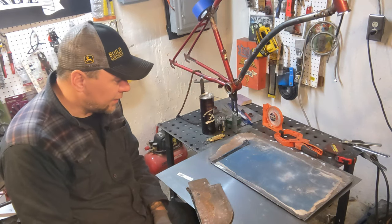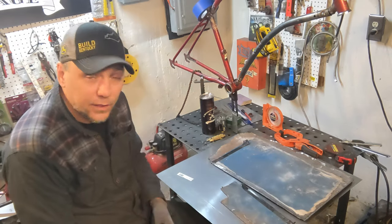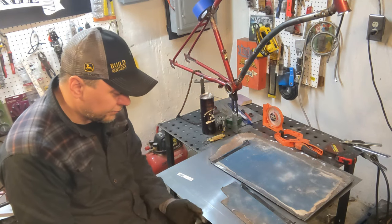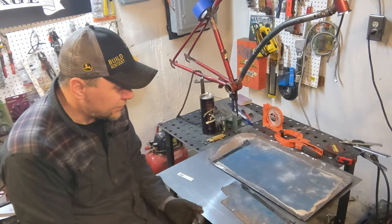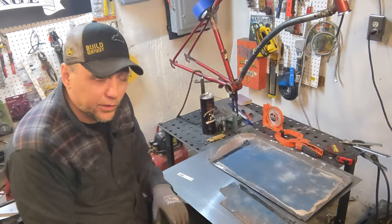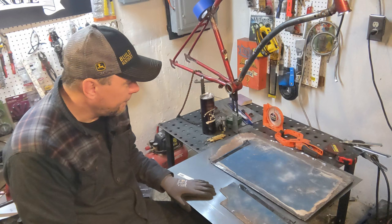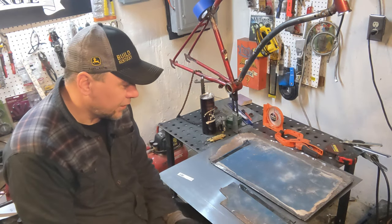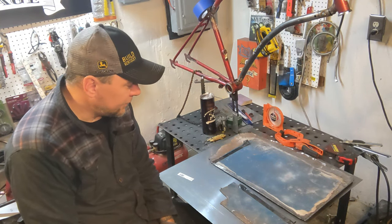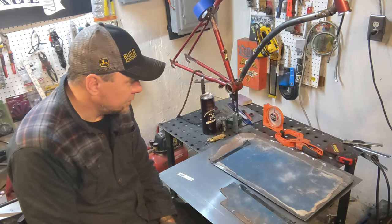Considering the replacement panel for the Willys — I want to say it's $140 — so we're saving $100 by doing it ourselves, even though we are going to have to build it in sections. I'm going to start tracing this stuff out, cutting it, and working it to fit. It's got this bend here — a quarter inch in and then half inch out — and this part mounts to the door sill. I think I'm just going to make all that separate, as I don't see much of a choice. I'll have to make this section separate and weld it all up.